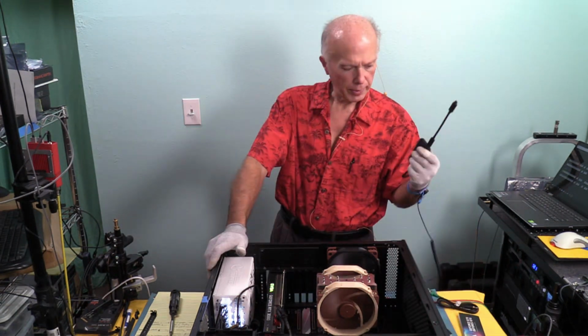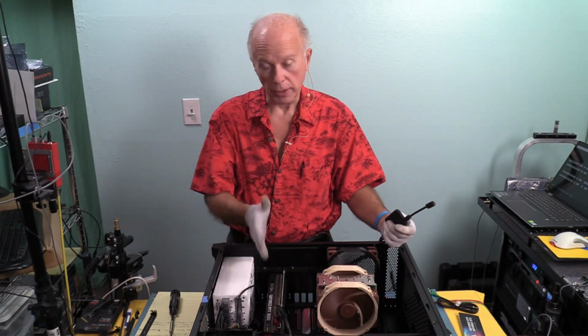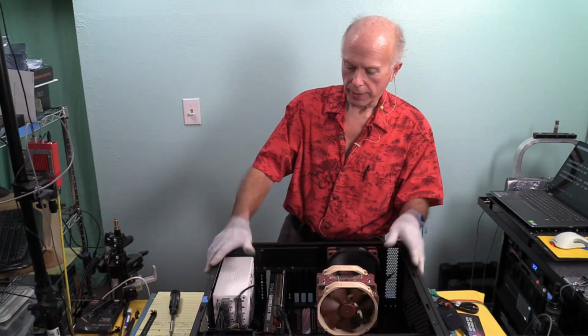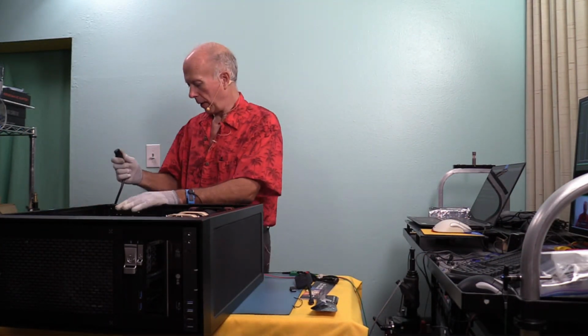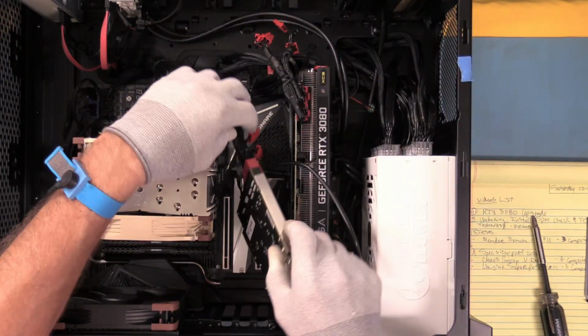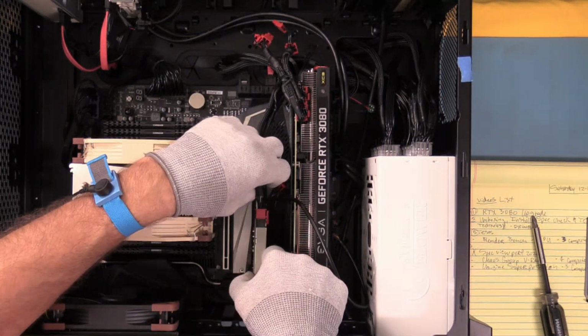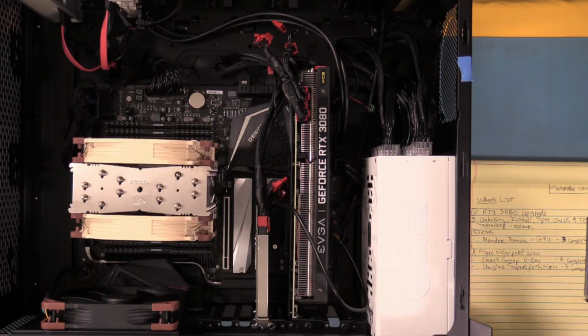Thunderbolt back in. All because I was going to show you guys this drive. If I hadn't done that, if I had plugged in Thunderbolt 3, you wouldn't know about the video card in Thunderbolt. So, amazing. Okay, system's off. Power supply's off. Drain it. Drained. Unplug. Okay, we'll take our Thunderbolt 3 card, and it can now go in the 8-lane slot where it has to be. It has to live in that slot. We know that for a fact. And the video card is happy where it's at now. We know that for a fact.